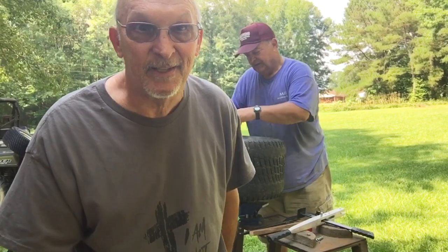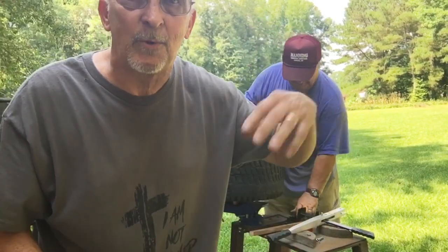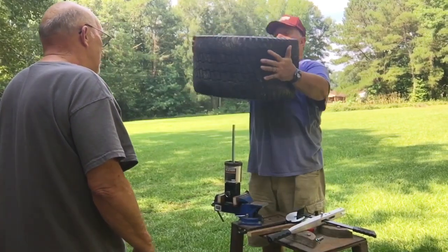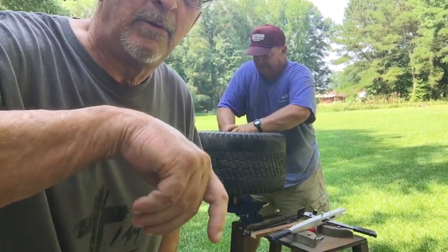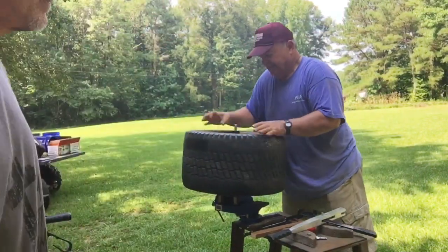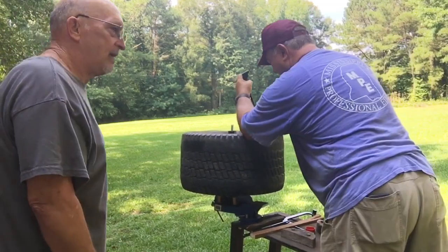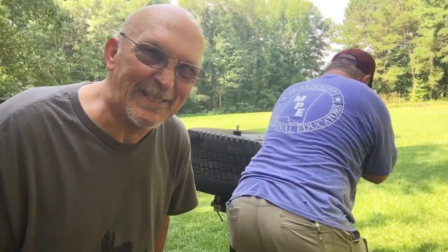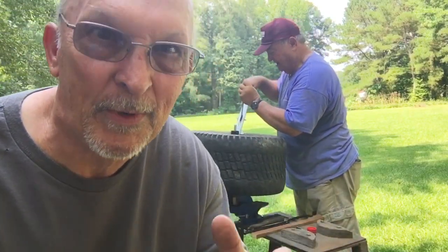It's not a big industrial machine, so there are a few things you have to do once you get the side broke. Then you have to take all your stuff loose and flip the tire over so you can work on the other side. We've learned that when you're trying to tighten this tire down, you tighten as much as you can and turn the tire a little bit, then you can tighten it a little more — turn the tire a little bit, tighten it a little more. If you have problems with it breaking that bead, let off the pressure and adjust the thing that's pushing on it just a little bit one way or the other. Get it in just the right spot and it pops pretty easy.